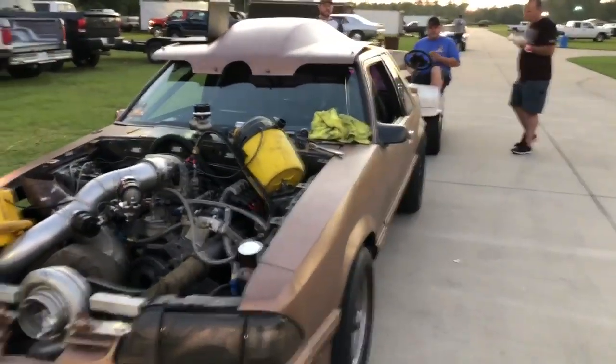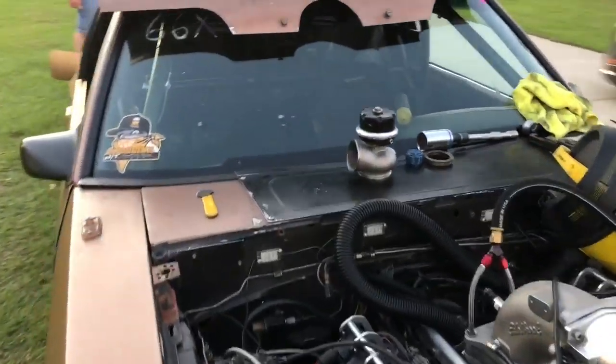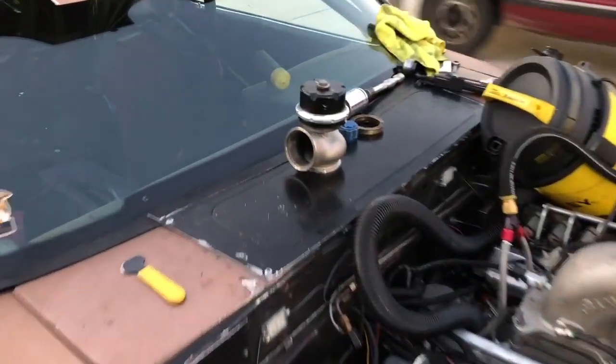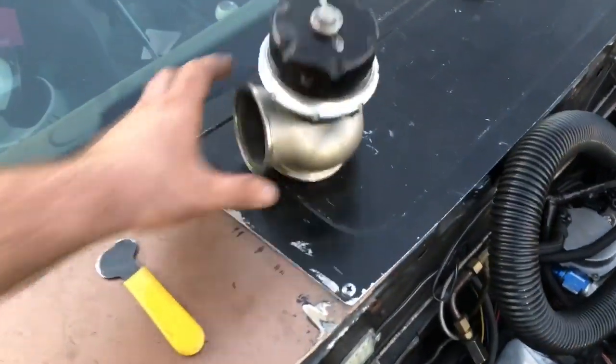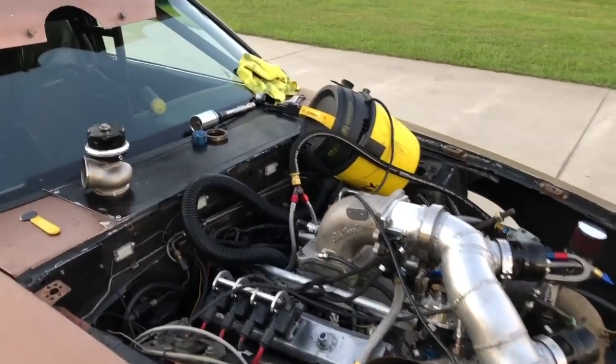We just pulled the data log. The wastegate stuck again, so that's why you see the wastegate stuck up there. I just basically put my old one back on. So this is the new one. You see it's got a nice shiny valve. It's all pretty. The one I got on there is exactly like this, but now the diaphragm on the other one that was leaking CO2 before is not really leaking.